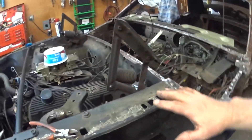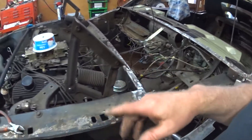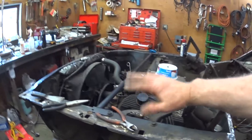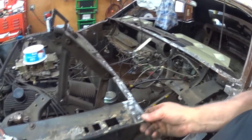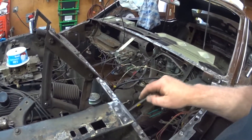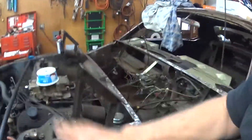I've got to get this thing trammed up so that all this stuff goes in square. Now I can see — with the connector on there, if you're in stock configuration and you're going over bumps, these are trying to move back and forth an eighth of an inch. That plus cornering loads, the instability of the shock tower, is what tore out those spot welds in the top of the cowl. An eighth of an inch back and forth every time you go over a bump — you can imagine how long it's going to take to tear out the spot welds.